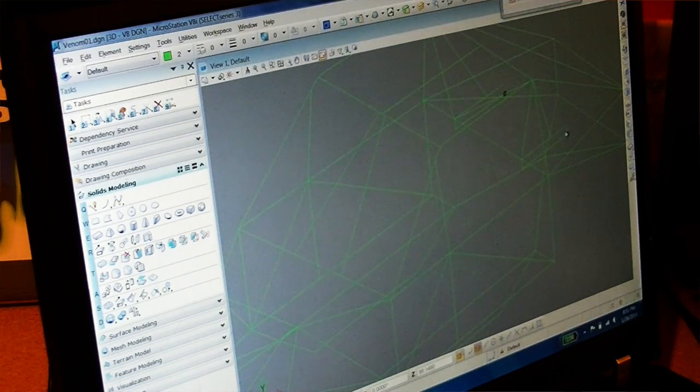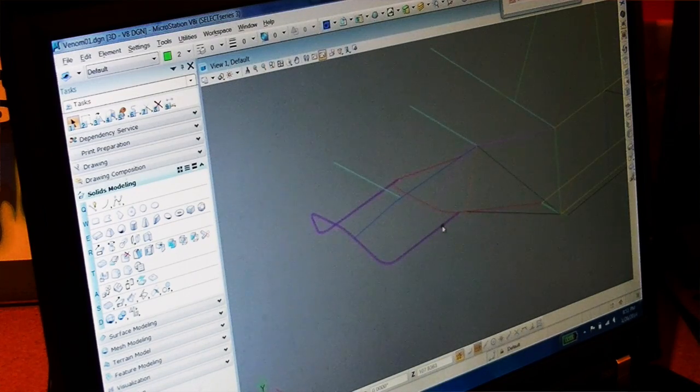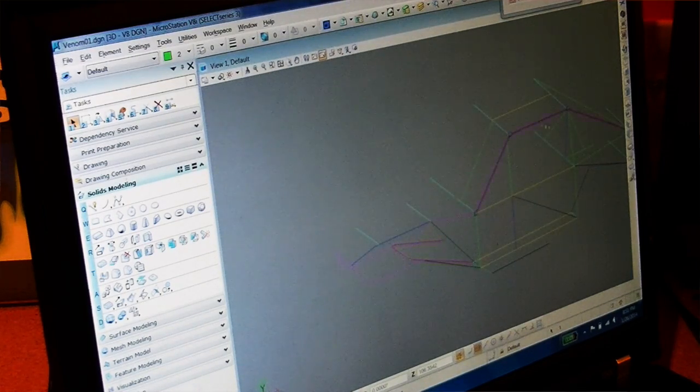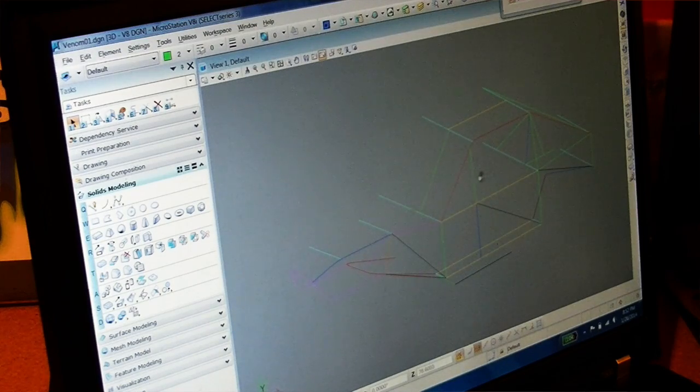I've also got a couple of pieces in the back — these will be where my rear shock mounts go. For the front and rear shock mounts I want to do some laser-cut sheet metal pieces fabricated together to more closely replicate what was done on this truck, as well as that desert style I really like. The different colors represent different tubes. Some tubes will be one piece with multiple bends — a lower structure with multiple bends — and my upper A-to-C pillar will be one piece. That's about all that will be multi-bend tubes. I'm only showing a little more than half the truck here because I'll take these tubes and extrude them along a path — my tube profile will be 3/16 inch steel extruded along those paths.